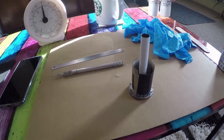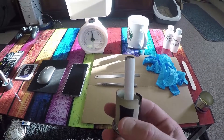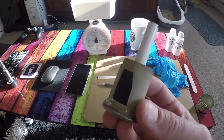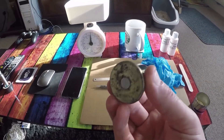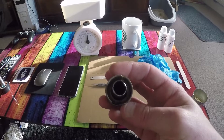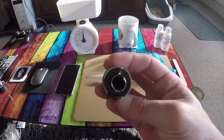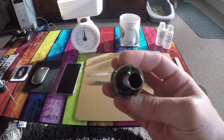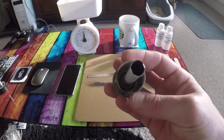Let's talk about the mould. What we've got here is the outer shell of the bushing — it has the slots in the side here underneath the tape, cut out in the middle. I have hot glued it down, effectively but not very neatly, onto a washer which has just the right bore diameter for receiving this little tube that I found, which is 11.5 millimetres diameter — just slightly tighter than what the pin would be on the BMW shift stabiliser. The gap in between, around that pipe, is what we're hoping to fill with resin, then pull off the washer and pull out the pipe from the centre and we'll be left with a decent bush.